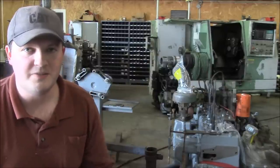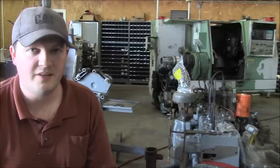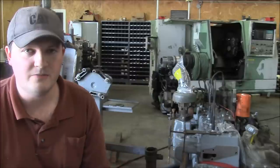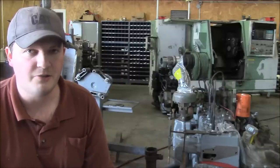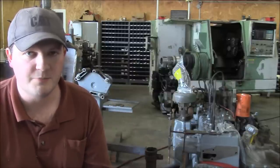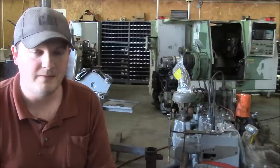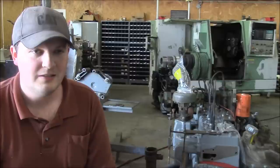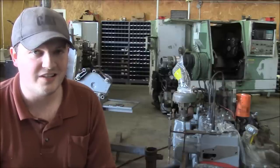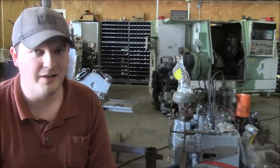Thanks for watching. I'm not sure what I'm going to do with the engine — I'm probably going to try to sell it. I think there's a pretty good market for these Continental engines; they used them in everything. If I can't find someone that wants the Clark spec, I'd be happy to convert it to whatever spec they want, as long as they had the right front and rear cover — and probably the manifold is different as well, but those are simple things to change. We know it runs. I wanted to assemble it and get it all put together so we could run it and verify it was a working engine. It was very important to make sure the engine runs with good oil pressure. I don't know if all these remanufactured companies actually run their engines before they ship them out — I suspect a lot of them don't — because I've been around a lot of remanufactured engines and seen some pretty shady stuff. I feel like if they had run the engine on a test stand, they would have found a lot of the issues I've seen. I certainly feel better about it knowing I've seen the engine run myself.